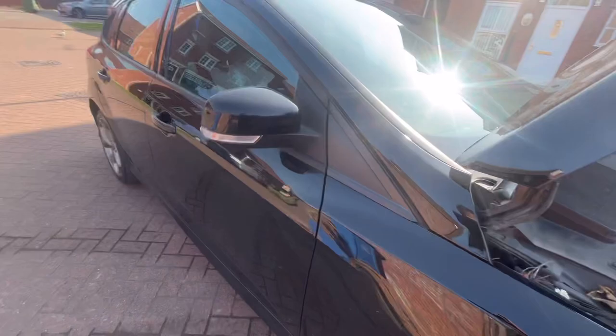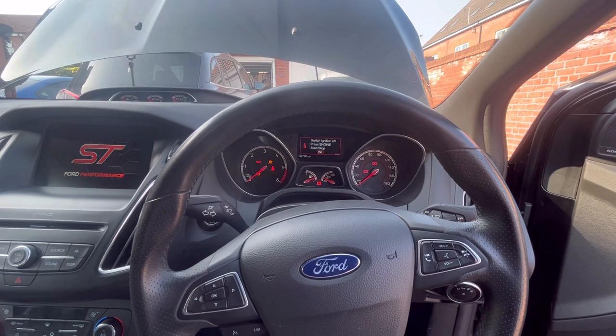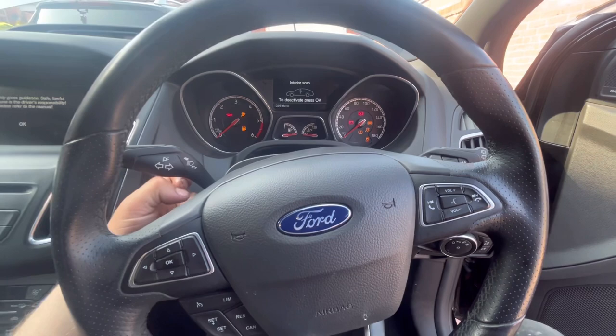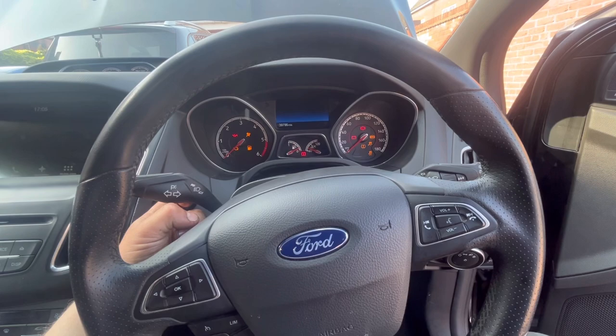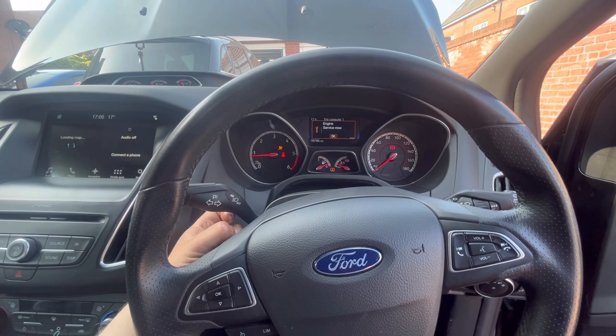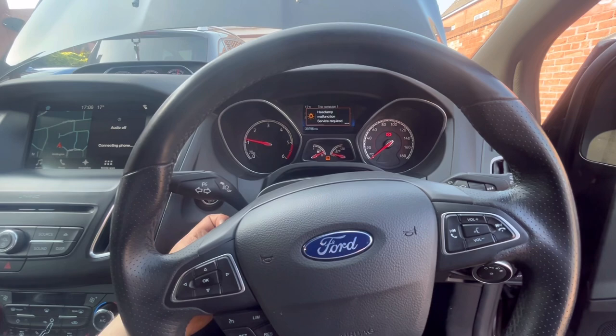So go around to inside the car. So, ignition on. So engine service now, that's because it's not got the fuel pressure up. On, off. On, off. On, off. And that's how I do it usually. And it probably will cut out when you start it. It just needs to build oil pressure. That's primed up, so yeah, that's how you do the priming procedure on them.